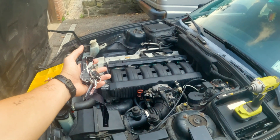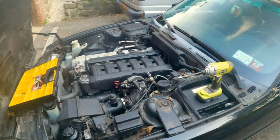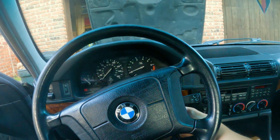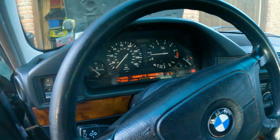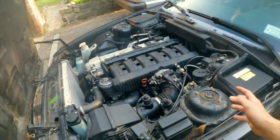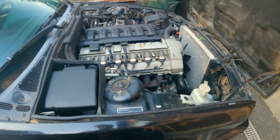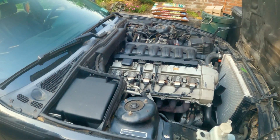Everything is plugged back in correctly, hopefully. Let's start it up, warm up the engine, and see if the fuel delivery problems are solved. If not, you'll probably see another tutorial for a fuel pump fix. It actually started up much more normal — that little chugging in the beginning was because obviously there was no fuel in the rail anymore. But the car started bogging again — it was smoother at first, but as you give it gas it starts losing power, idling really low at like 500 RPM. I still believe it's a fuel delivery problem — I think I'm gonna check out the fuel pump.